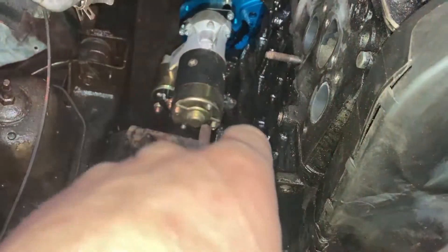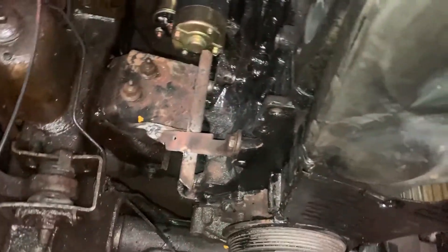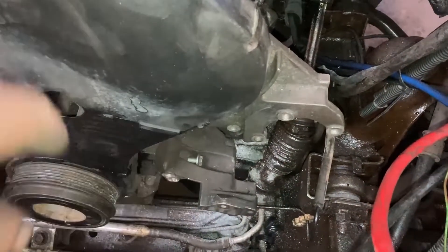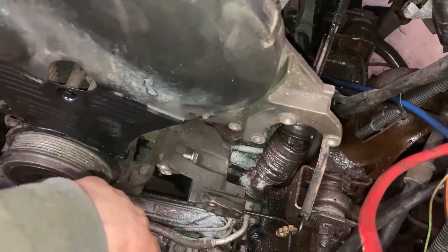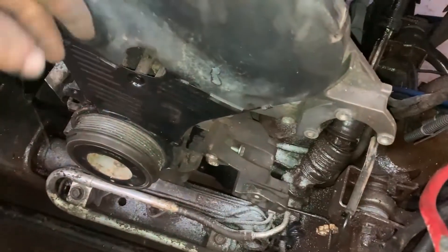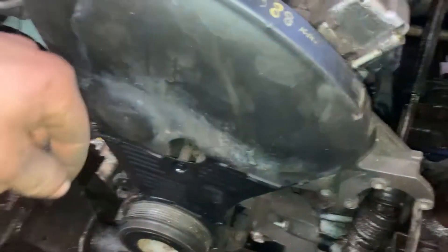The coolant line is going to clear, the starter clears, and there's enough room to wiggle it out and change it if you had to. As far as the serpentine belt goes, I should have no problems — this is the factory location for the mounting. The power steering pump is here, the alternator sits here, and the AC compressor is down there but I don't have AC. So I should be able to just buy a belt for a TDI without an AC compressor and run the belt as per usual — at least I'm hoping so.